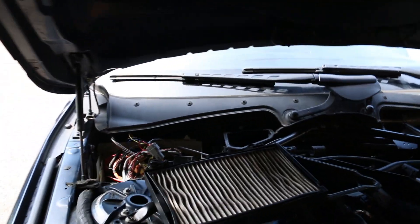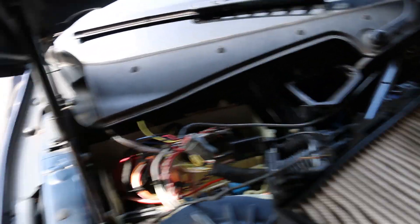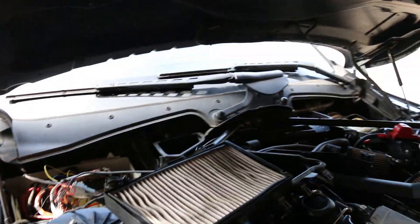Now it's time to button everything back up. Put your flex fuel module and wiring in a way where it's going to be out of the way and stress-free so you're not pulling on any wires on either the flex fuel harness or the DME harness. Then put the cover back on, wiper cowl back on, and go for a test drive. That's pretty much going to do it for this video. Make sure to like, share, and subscribe for more E60 content — stuff that maybe not everybody does with their E60 and there are no DIYs out there for, kind of like the flex fuel. I haven't really seen the Motive flex fuel done on an E60 yet, so maybe I'm the first.